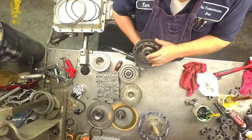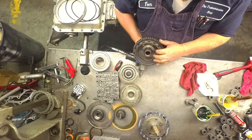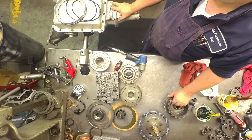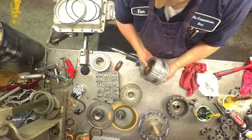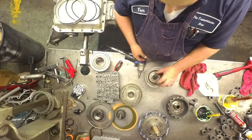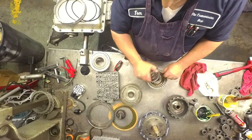This bushing here — when you put it in, go out to your driver side axle and make sure it fits in nice and easy. You don't want to get the unit totally installed in the car and then find out this bushing is too tight. On the back of this drum here, I don't have the resizer for this sealing ring that goes here, so I always put a hose clamp on it right before I'm ready to set the sprag assembly, because it seals right inside here and this makes it a lot easier.